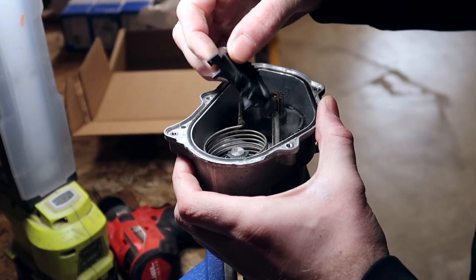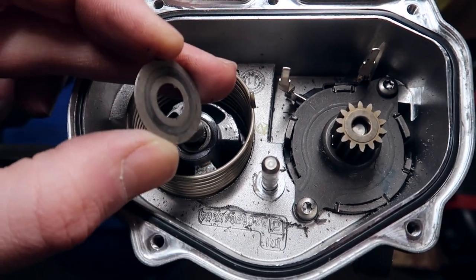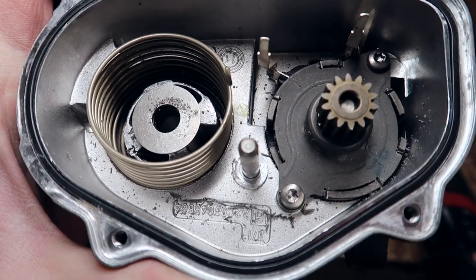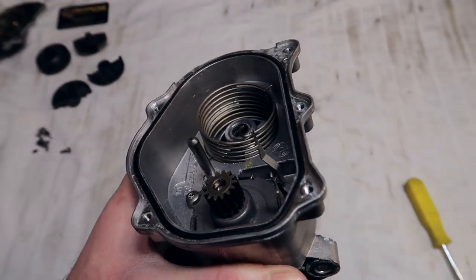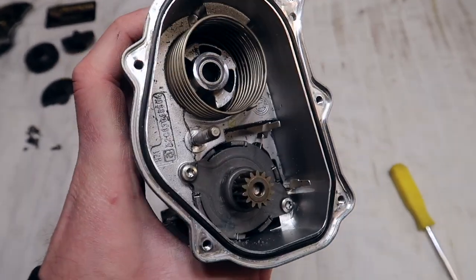Unloosen your vice grips, tighten it up right about here, and twist — this should break off, just like that. The gear is broken off and you can freely remove it now. When you are removing everything inside, make sure not to lose anything — there's a little spacer here. The shaft comes out pretty freely. Before we continue, take an air compressor and blow out all this grime and dirt from the inside, because you want to work in a clean environment.